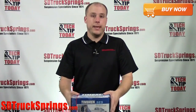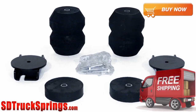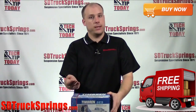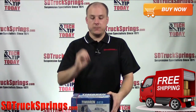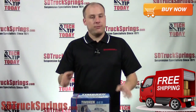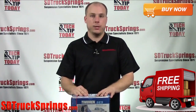When you receive your product in the mail, you're going to notice that included in the kit are two Aon rubber springs and two upper brackets. These brackets are going to bolt to the frame of your vehicle. They're labeled left and right for the left side and right side of your vehicle. There are two spacers in here — the spacers are optional. When your vehicle is unloaded, you're going to want a half inch to one inch of space between the axle of your vehicle and the Aon rubber spring. You'll also find your necessary hardware — two bolts — to bolt this product onto your truck or SUV.